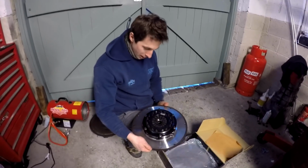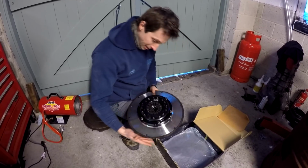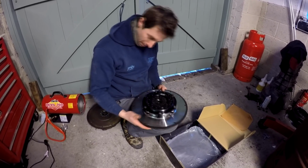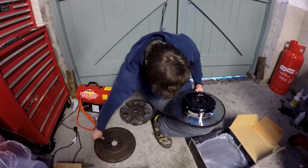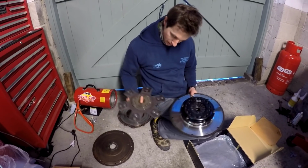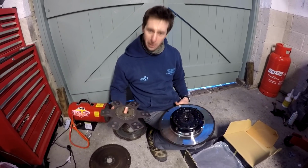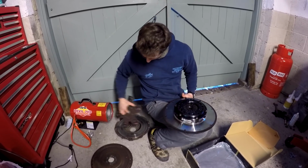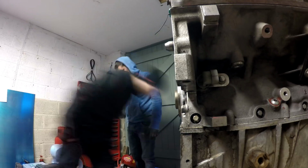So I think it's pretty obvious what we've got here is a much smaller multi-plate, triple plate, I believe, clutch. Compare it to the old original version that we had before. This clutch has definitely done us well, maybe 3 seasons, maybe even 4 actually. But now that's warped, and so is the pressure plate, so time out with the old and in with the new.